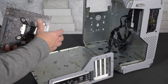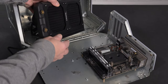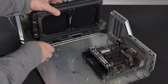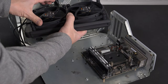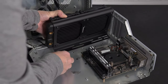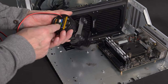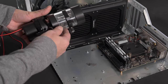The SSD is not immediately obvious because it's on the back of the board — a Samsung 960 Pro. The radiator is a 240mm Black Ice from Hardware Labs. The Barrow logo is because it's mounted on a bracket so I can position it like so. We've got a pair of Be Quiet Silent Wings 3 fans on the bottom — 120mm obviously because it's a 240 rad. The final piece of the cooling system is this Aqua Computer D5 pump, which is controlled over USB, along with an AlphaCool reservoir on top.